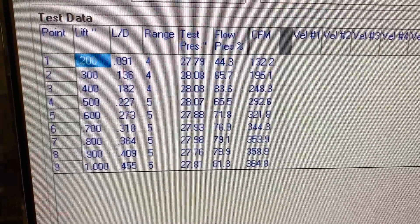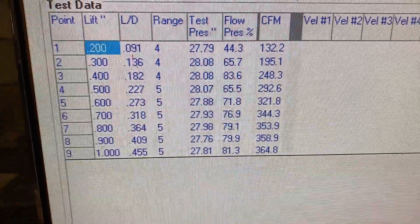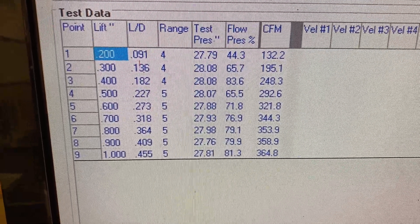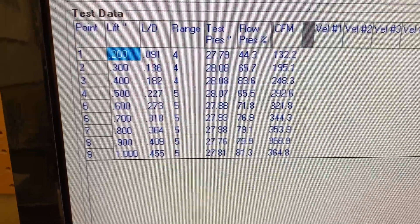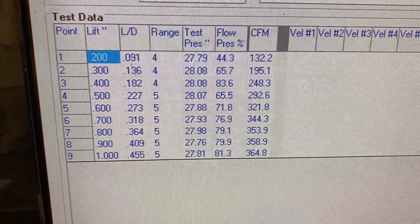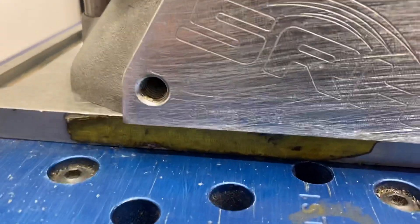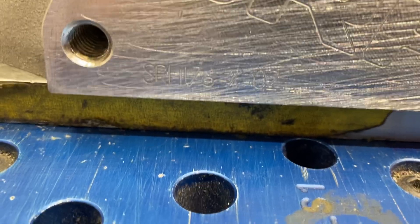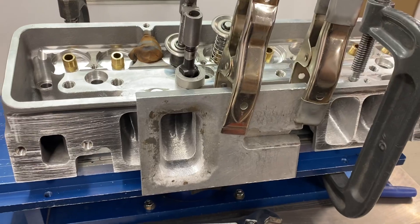Got a full line. Most of you guys know that. Same casting: 205, 227, 250, 265. Getting ready to come out with the 275 port. Dedicated small bores — 4060 wide. Big bores: 4140, 4145 wide. Got a lot of time in them. Dedicated casting. If you can see it — SRH. Doesn't have that on it, it didn't come from this shop. Great cylinder head. Profiler does a great job.